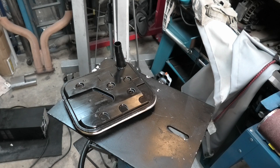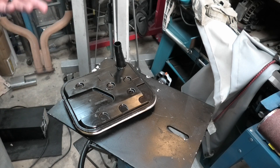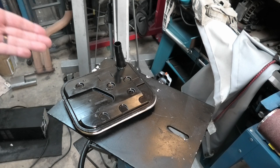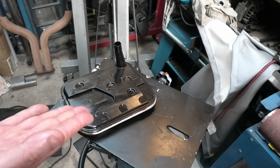I'm going to try and demonstrate this the best I can. If you haven't seen my previous video, I've been troubleshooting a line pressure issue with my transmission. I've had the transmission out 4 times, put it back together 4 times, the shed floor is completely covered in ATF, and I've had a rough 6 weeks. The problem is the filter — the whole time it was the filter. From day dot, from first fire-up, it was the filter. I had no line pressure the first time I fired up this transmission, and it was the filter.